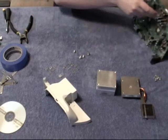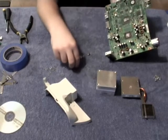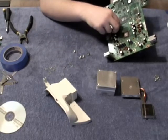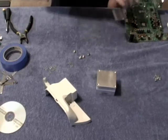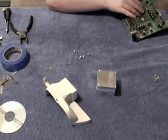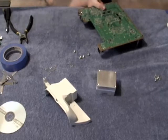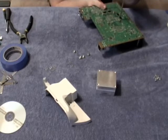Place your hands over all four screws to hold them in place and flip the motherboard over. On each one of the screws on the top of the motherboard, place a nylon washer and then a steel washer. Again, the nylon washer is there to protect the motherboard from the pressure of the steel washer. Once all the washers are in place, place the heat sink on top of the screws. Then while firmly pressing the heat sink to the motherboard, quickly flip the motherboard over. Screw each screw in to just about hand tight.